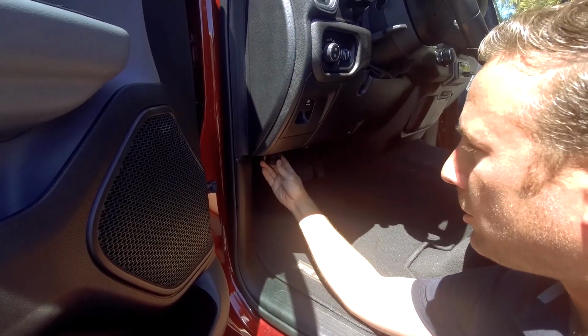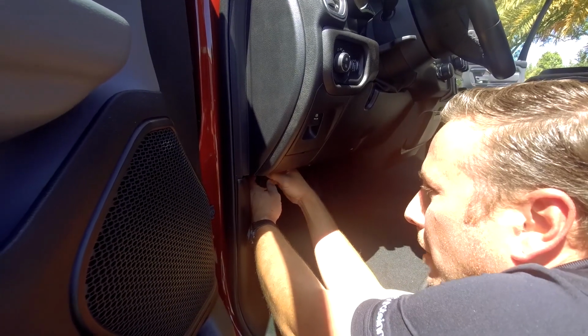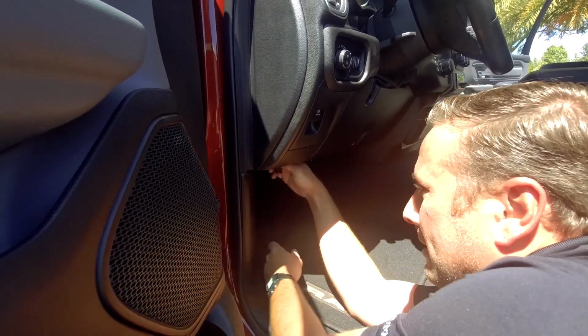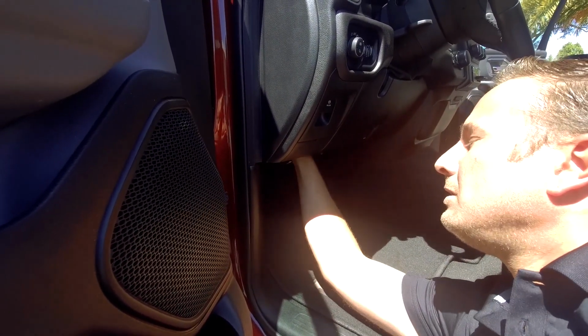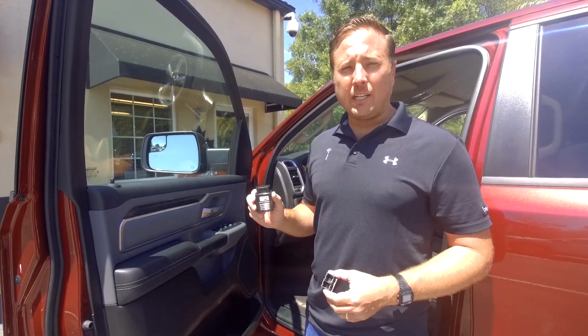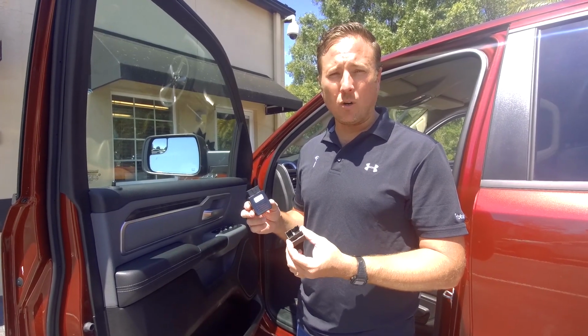All right, we shut the vehicle off. Now we're going to disconnect the two plugs we plugged into the bypass, and we're going to plug these two plugs back into the gateway module. All right, this now completes the OBD Genie programming process. You can now stow these away. You will not need them anymore.